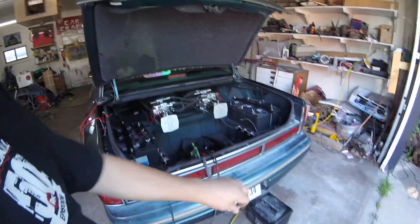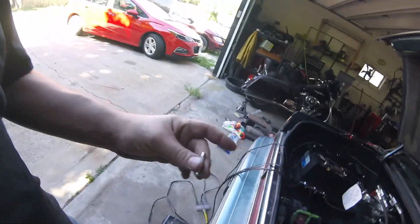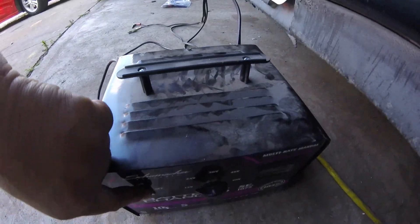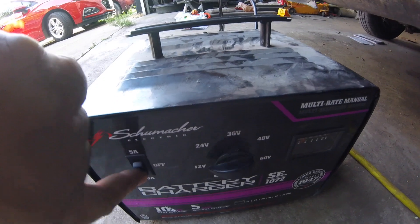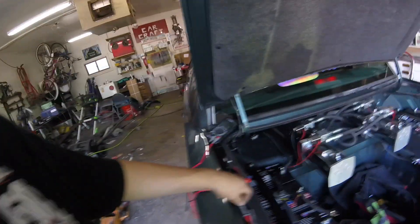Anyway, that's your problem right there. Battery charger isn't charging. Really stupid. Because, okay, this is the fuse that goes in it — listen to it. It still buzzes like it's charging. So if you got one of those cheap battery chargers, be aware of that, because it'll still buzz like it's working and everything's fine but it won't actually put out any current. The only way I found out was I put my multimeter on the ends of the clamps and it said no current.